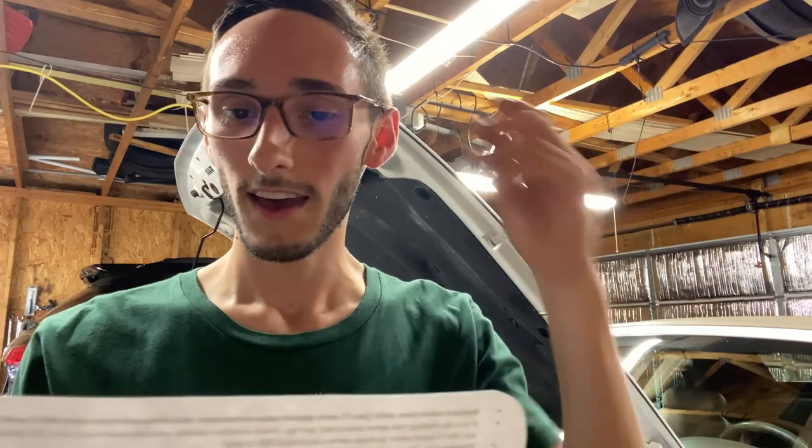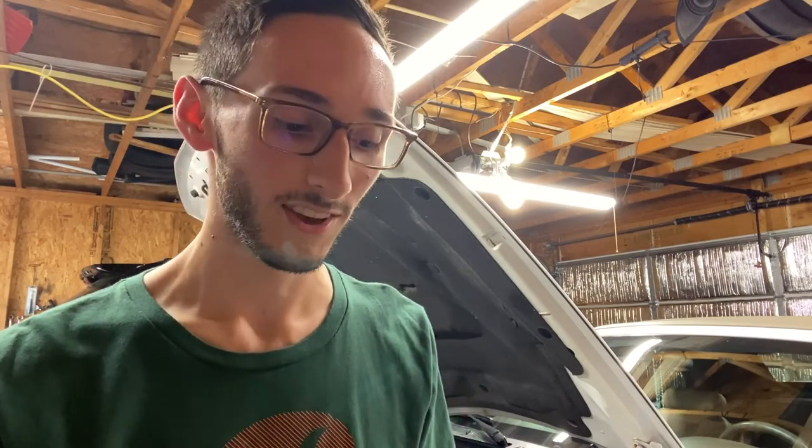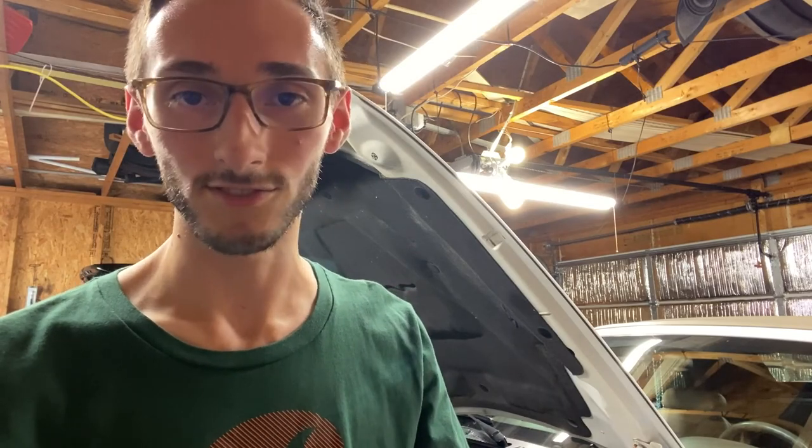Let's talk about degreeing. Degreeing isn't necessary for a lot of cams, but you'll more than likely make the most efficient amount of power with a degreed set. Now, sometimes you can get lucky, install a cam straight up, which is just, you know, without degreeing it, and you won't have any issues. Like, the car is gonna just run as if it's spot on. And that's what happened to me with my MHS Stage 2 cams. I got them degreed by MHS themselves, because, I mean, why not? It was super easy to just drop them in and be done with it.